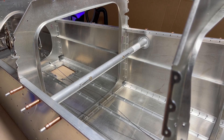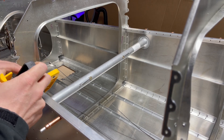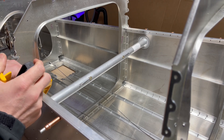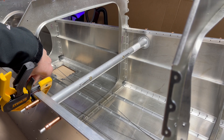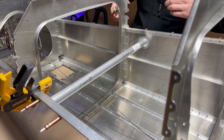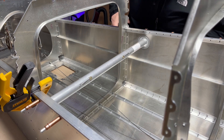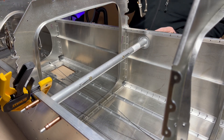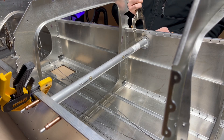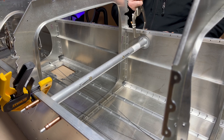So it won't interfere with any of the control surfaces, control cables, rods, etc. Let's get this thing clamped up. Measured it exactly 2 inches from the flange on the bulkhead to the flange on the pull handle. I only have one of those smaller clamps so I'm going to have to use a C clamp with a little piece on the outside for protecting the skin.